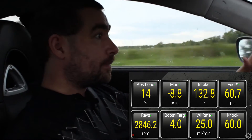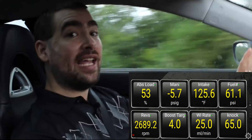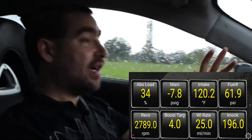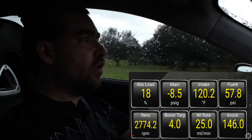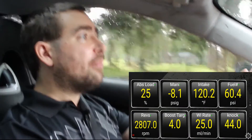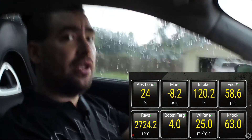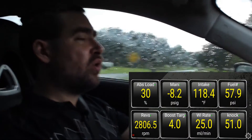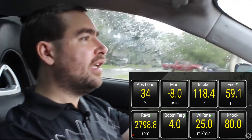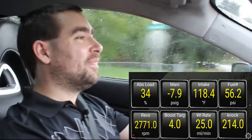Definitely need to figure that out. But gosh, this is just such a joy to drive. If you think 4 PSI is good, I have had it up to 8 PSI before, but not with this electronics version. My next step before going further into boost will be to get a better knock baseline for the entire RPM band — that way I can cut boost or add water injection if I start getting any detonation. I'm not really worried about that at 4 PSI. I also need to get my fuel pump pressure controller working so I can make some coarse adjustments without re-flashing every time I want to change a little bit of the fueling. I would like to have the ability to do coarse adjustment on ignition timing as well — that would be really beneficial, especially when I start playing with lean burn and want to get into cruising. So I have a lot of things left to do with this. It's going to take a while, but right now I'm happy.